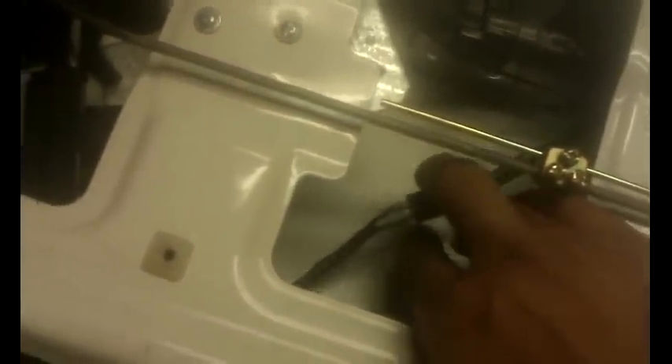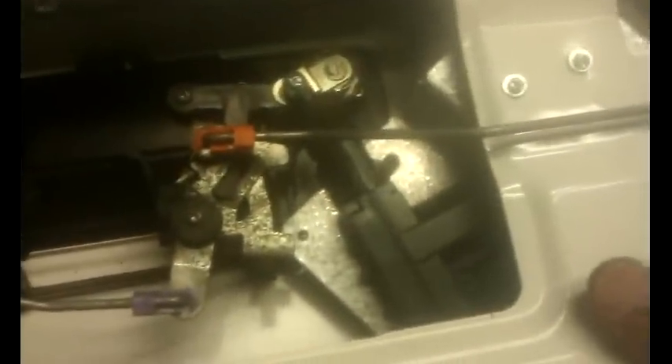I went to Home Depot and bought a 3-wire cable, and a buddy of mine has a junkyard that had harnesses, so I wired up a 3-pin plug — two wires for the lock and unlock actuator and one wire for the tailgate unlock. One wire is grounded, so these two got wired together. Here's the lock and unlock actuator. I'll put the tailgate on and see how it goes.